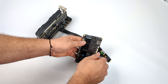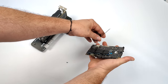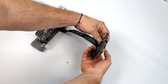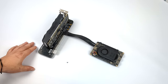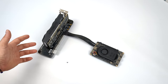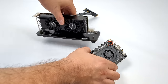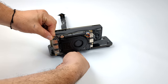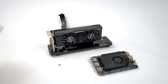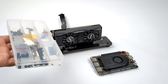Basically what we're going to do here is plug the GPU into the dock itself, and then we'll insert the M.2 end into our free slot on the Latte Panda 3. From here I will be powering the Panda separately from the GPU — unfortunately it's just not going to put out enough power over that M.2 to power this GTX 1650. So I've got a 24-pin Dell power supply that'll plug right into the dock itself, and I could rig something up to also power the Panda from it, but for this one I just want to get it going and see if it would be worth doing in the first place. I'm actually going to be mounting the Panda right on the front of the GPU dock itself — pretty easy to do with standoffs, and I could definitely figure something out to get it looking pretty decent in a nice little compact form factor.